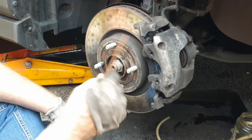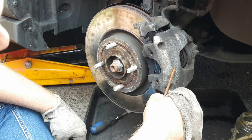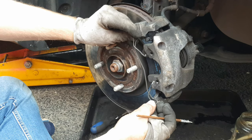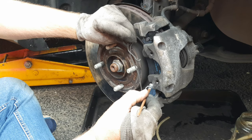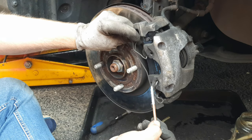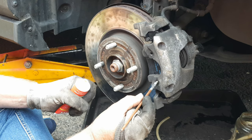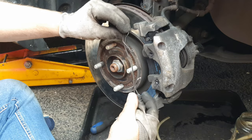These calipers, in common with a lot of cars, are made of a zinc aluminium alloy known as Zamak. You can see this slight white marking on the surface — that's the zinc component corroding; zinc oxide is white and forms like a white powder. One of the problems with these zinc alloy calipers, particularly ones with this type of clip, is that the steel clip and the zinc alloy cause sacrificial corrosion inside the hole, which can cause the springs to become stuck. Since this is not very old and it's the first time it's having new pads, clean out the hole — perhaps with a small drill — and put some Ceratec into the hole; it won't wash away and it'll help keep dirt and water out.